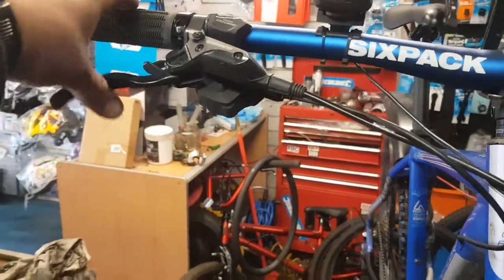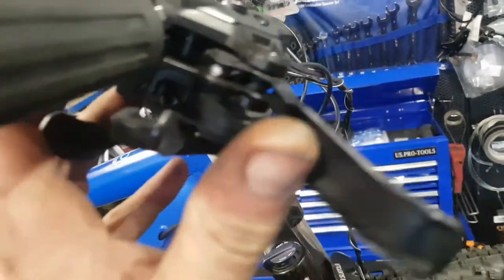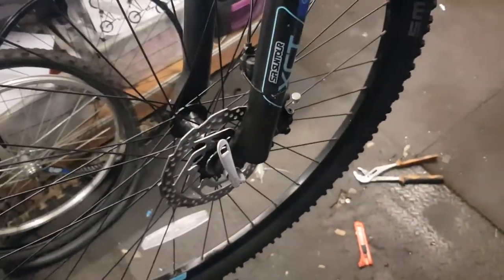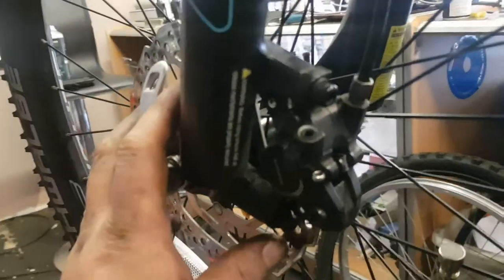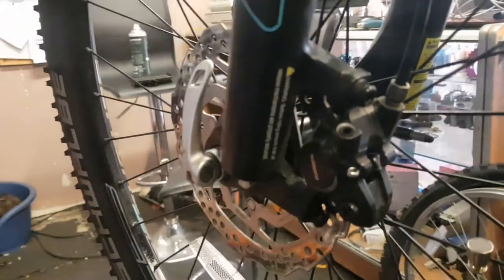The wheel's back in. Close up the quick release. It's spinning nice and freely — just check how free it spins, make sure it doesn't bind. Pull on it and we've got no squeaking now. The lever pulls in nice. You can adjust the lever using that grub screw there with the two mil allen key — screw that in and it'll pull the lever out, make the brake feel a little bit better, but the reach will be more. So that's pretty much it. If it is rubbing on one side of the disc, undo those bolts and pull on the brake lever to centre the brake, then tighten them both up while holding the brake lever and that should centre your disc. I hope this helps.